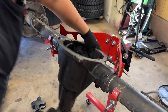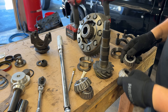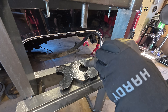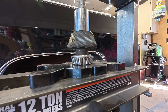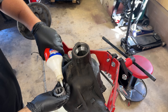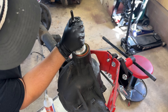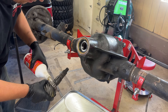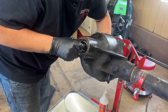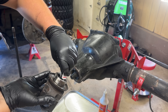We tear everything back down to an empty housing. Now that we've verified everything is in spec, we take off the setup bearings and press on the actual bearings. The 36-thousandths spacers are still on there, so we slide on the bearing, take it to the press, and seat it. Back at the housing, we drop in the outer bearing, drive in the outer seal, and send the pinion gear up through. We lube up the bearing and make sure to throw on the crush sleeve. Then I put a light film of RTV on the yoke splines to hopefully prevent a leak.